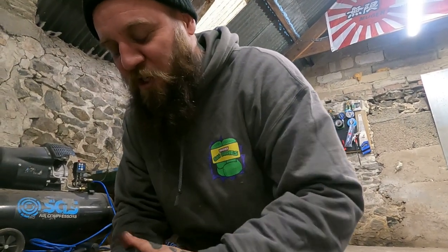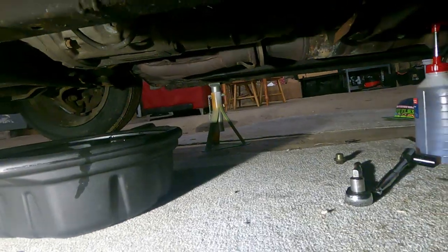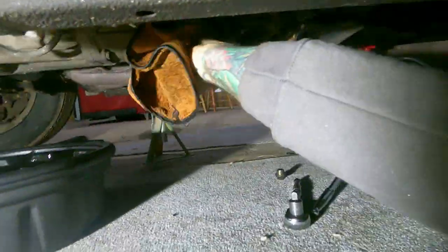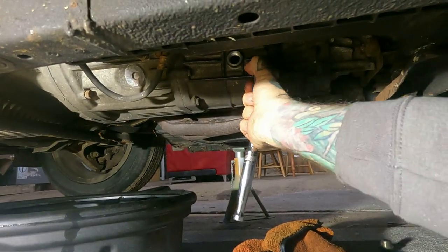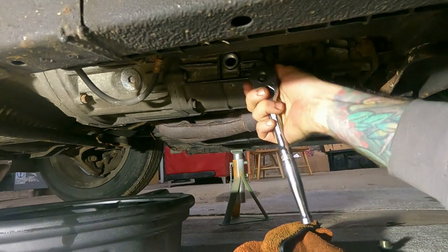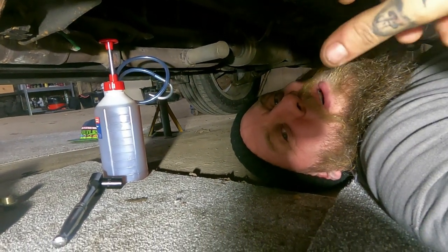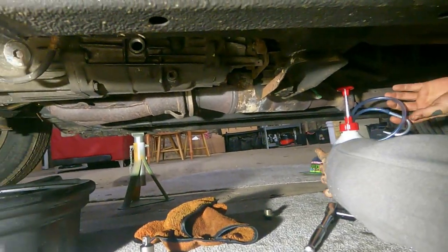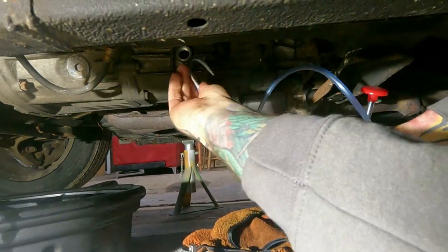Let's check we've got the right stuff — transmission fluid, MTF-3 Honda. It has to be MTF-3, guys — always MTF-3 for the S2000 gearbox. Also, there's a maintenance thing you can do on your shifter where you re-grease everything — apparently it makes it silky smooth. We'll be doing that at some point. These are quite notchy gearboxes anyway.